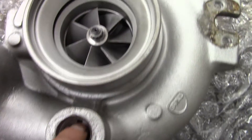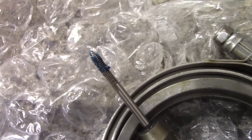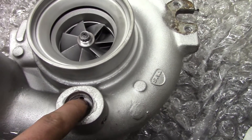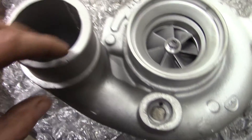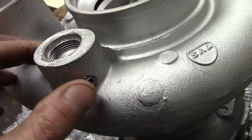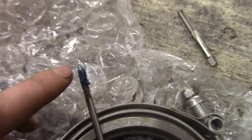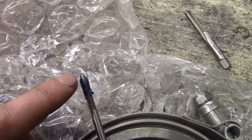I don't know really what it does, but if you shine a flashlight through it, the light comes out in there. That hole has to be plugged, and as it is right now, it's a perfect size for a 10-24 tap. I've got a tap all set and ready to go. I put some grease on it, partly for lubrication, but also to catch chips — it's even better just to catch them before they even fall off into that hole. And you'll notice that I stuffed a rag down there, because this hole connects into the main passage. Also, there was a little hose barb here that would have gone to the wastegate actuator. I tried to pull it out, but I broke it. So I'm just going to drill that out, and that should be a good size for a quarter-20 set screw. I'm going to tap the hole partially so you still kind of have the lead-in of the tap there with the incomplete threads, so when I run a set screw in there, it'll kind of seal up and jam against those threads, kind of like pipe thread.